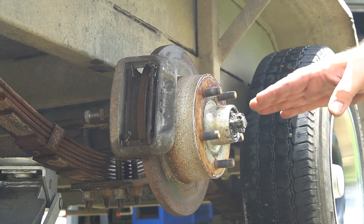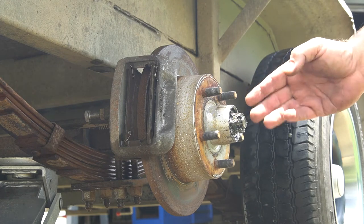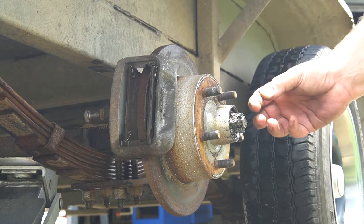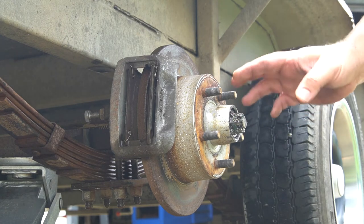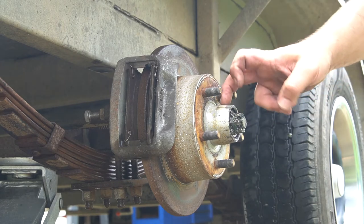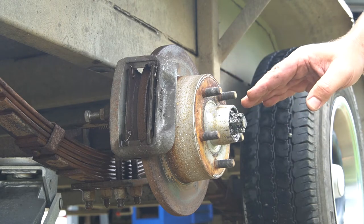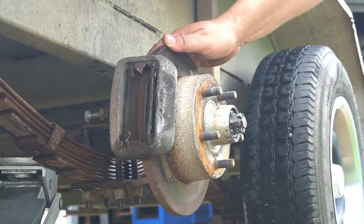Keep in mind that the adjustment is a bit rough — you can either leave it where it was or rotate it to the next flat, because your split pin has got to go back in there, so there's no real fine-tuning adjustment. Unless you've got a serious problem, you shouldn't have to go two flats because that would just over-tighten the tension or preload in your wheel bearing. We've just turned the nut one flat — let's check it before we put it all back together.